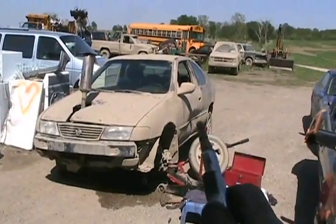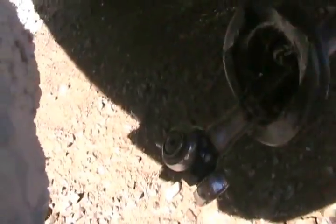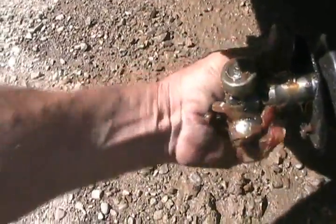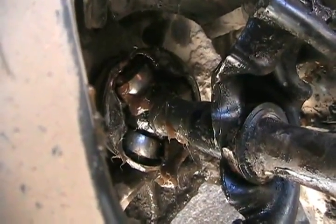Well, I do have to blow the water out of those needle bearings first, so it doesn't displace the grease. Good enough. Now the dirty job. Someone's got to do it. Yuck. I felt slimier if you know what I mean. Good enough. Now some for the pocket. Get her in there. Oh, I'm just straining my arm, getting in that tight space, that's all. Now ball joint's back in, and the part is riding deep enough into the pocket that it won't pop itself out again.